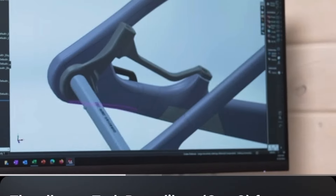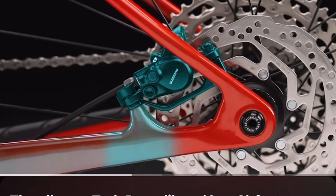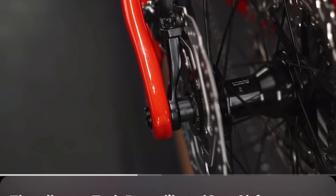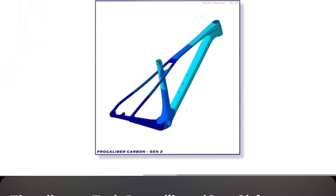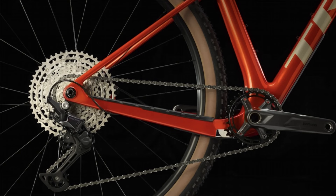As for some other impressions on features and spec, this bike still comes with the same MT200 Shimano brakes that I have on my bike, which I find to be very solid. However, another new change that may be noticeable in the bike's performance centers around the floating rear brake mount, which mounts off of the rear axle, not the rear seat stay. Trek claims the reason for this is to facilitate the frame's ability to flex and dampen without interference from brake forces. The drivetrain is Shimano Deore 1x12, same as my prior gen bike, which is also very solid.